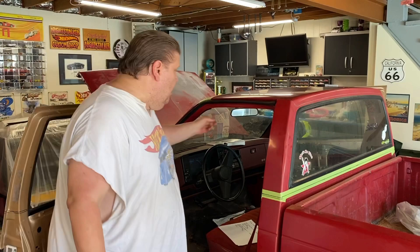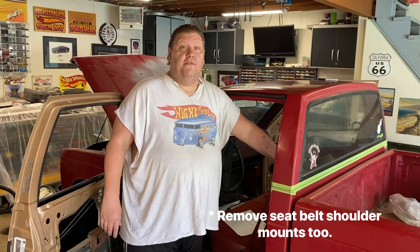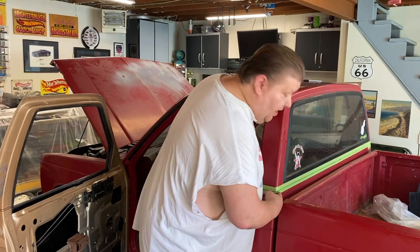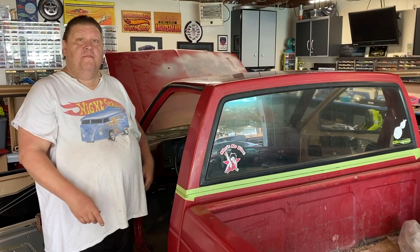Before you start your cuts, get all your trim rubber out, then your door sills — unscrew those. Next, take your headliner out, then your sun visors. Once that's done, take your seat out or move it forward, whatever works for you. Before you start your cuts, I like to start on the cab wall: come in a few inches — at least five or six inches — drill a hole on your line, do the same on the other side so you've got holes on the inside of the cab. Then match them up so the inside cab line, since it's double wall, matches the outside. If you don't do that, you're going to have problems.